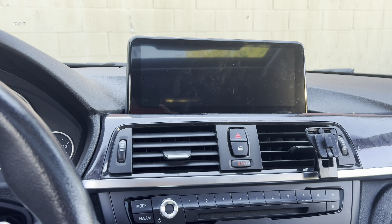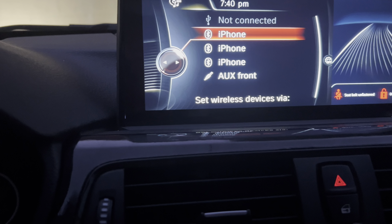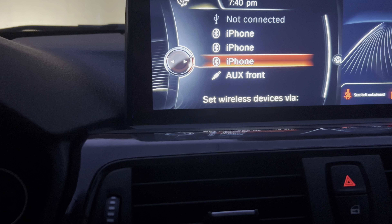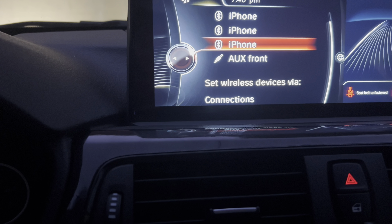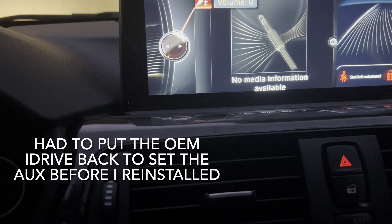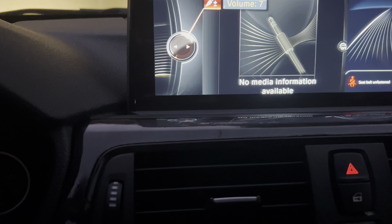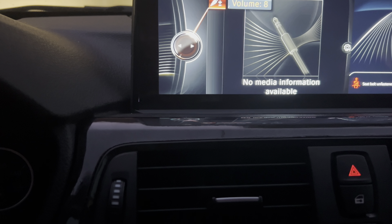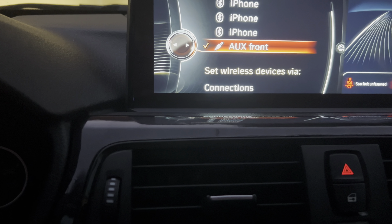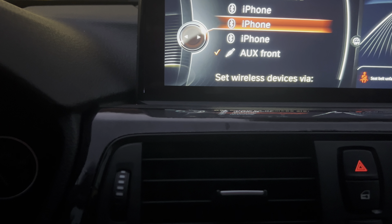I need to put that cover back on and I'll go through the screen with you again. I had some technical issues — when I plugged everything in, my iDrive was just frozen and I couldn't move it at all. For some reason I had to pull everything apart and go to the aux input and literally set it to aux at all times. I didn't do that the first time and it wasn't allowing me to move anything on the iDrive. But now that I've got that sorted, I'm able to connect my phone and everything.